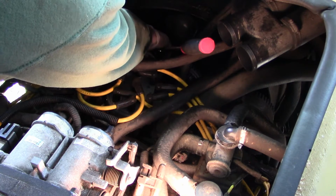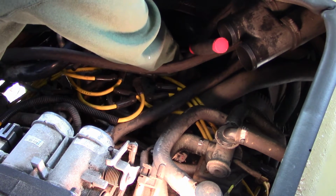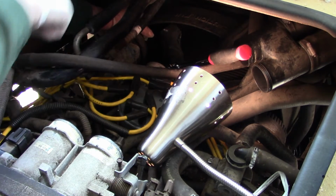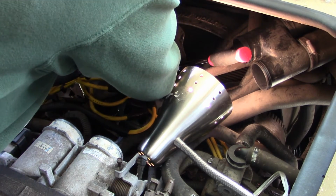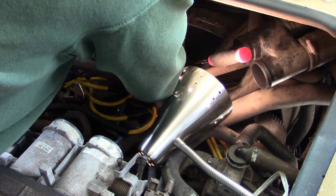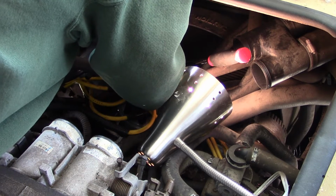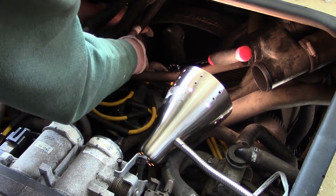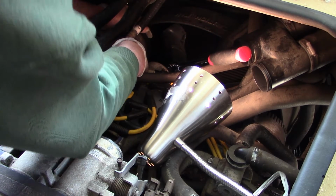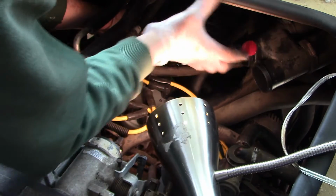All right, so I've got it wrapped around the crankshaft pulley. I can see down here on the water pump pulley. I'm down here to my left. I can see that I'm around the power steering pump pulley correctly. I think I am. And I have it wrapped around the tensioner pulley, which you can't see. So the only remaining pulley for it to go around is the air conditioner compressor. That's going to be the one I put on last as I pull up on the tensioner, on the ratchet.